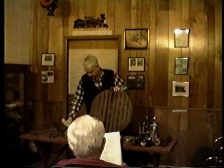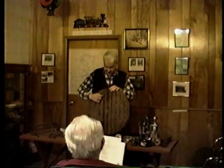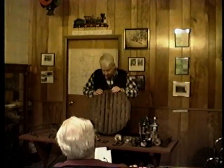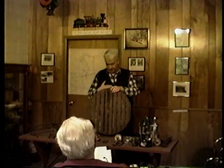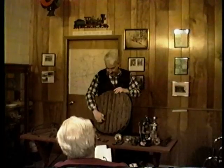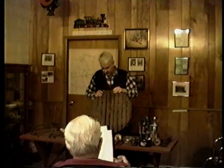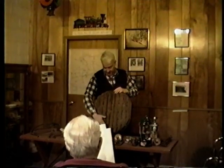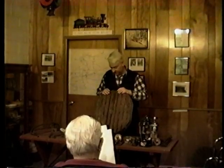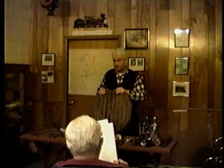And this is one we just took out of a car last week, and it had a problem we didn't know about. I don't know if you can see the crack in it. All this car used to do was backfire. Well, here's the reason, because this burner plate, the inside burner plate which was on here and crimped over, had a leak. It was leaking out through there. So that constant pressure wasn't in there anymore. And although this was filled up with insulating material, what they call today the bad stuff, asbestos, you couldn't tell it was doing that. Even if you looked in there through the pilot peephole, there was no way of telling.